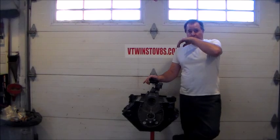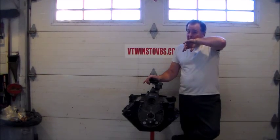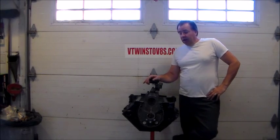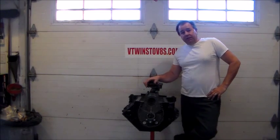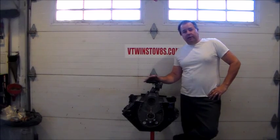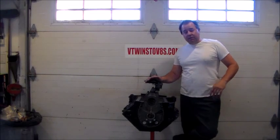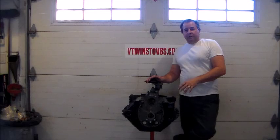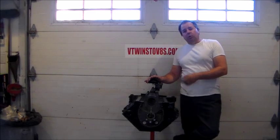What's happened at this point is I sent the block and the crank to the machine shop. After a little bit of further inspection we had a couple of spots on one of the cylinders that was pitted from sitting. We ended up going oversized — we were already 30 thousandths over, so it had to be bored to the next size. 40 wasn't going to get it because the pit was that deep, so we went to 60.